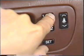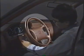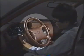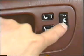In this case also, as in problem number 1, the tilt and telescopic steering and the seatbelt anchor positions do not adjust when you press the return switch. When you operate them using the manual switches, the tilt moves a little and stops before it reaches the desired position. But the telescopic adjustment functions normally. The seatbelt anchorage position is adjusted correctly also.